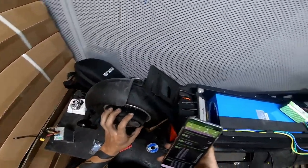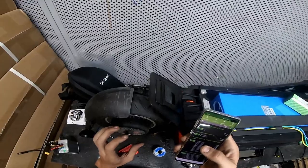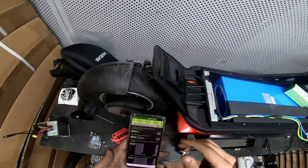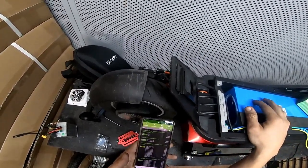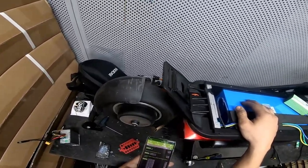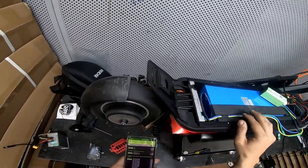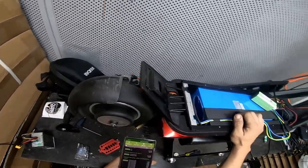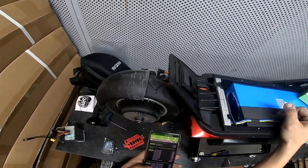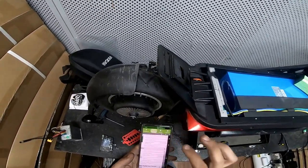This is the correct response of the motor. Slow whining, it turns slightly in any direction, doesn't really matter, and it whines just a little. Then we copy that and go for the second run, and we just wait. What it does, it recognizes the angles of the Hall sensors, so the operation will be precise and efficient. And copy. We are basically done configuring it on the app.